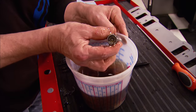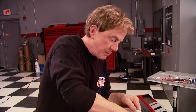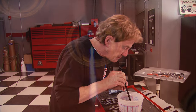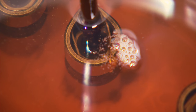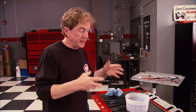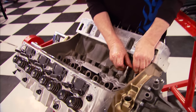We've been soaking our Comp hydraulic lifters about eight or nine hours now, and they're ready to go in. On the website forums, about half the guys insist on pre-pumping the lifters before installation. If you've never done this, you take a push rod and just push down on the plunger until all the air bubbles are gone — that means the lifter's full of oil. Most manufacturers like Comp discourage pre-pumping, saying that a lifter full of oil will cause the valve to open during lashing. I'm not telling you what we do.